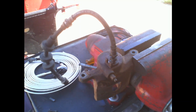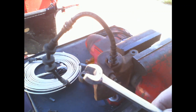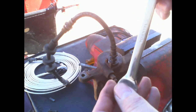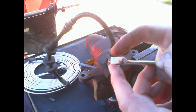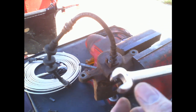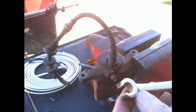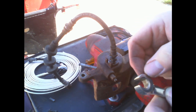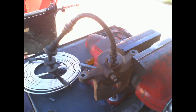And what I also brought were the flare nut wrench sets. Now, I remember these are Snap-ons, and I only buy their flare nuts mostly because of the thickness. Matco makes them, Crescent makes them, and Craftsman and Harbor Freight and all them, but they're not as thick, and I really like the thickness. Now, I do have a set of thin stuff too, just for the smaller ones, but having the thick set definitely helps.